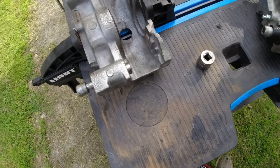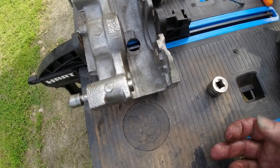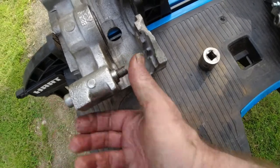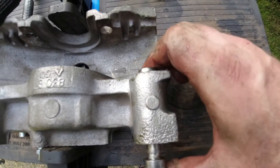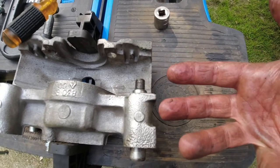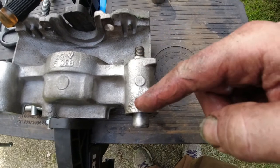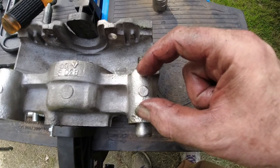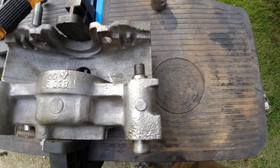I wanted to show an example of when something goes wrong. I just put this slide pin in here using a C-clamp to compress it so it would actually go through. Here's the thing: I should be able to push this back and forth with my fingers easily, and I can't move this at all. If I can't move this with my fingers, the braking system won't work correctly. What I'm guessing is going on is that one of the grommets is slightly twisted or cocked. It's putting enough pressure so I can't move it, so I'm going to have to completely remove this and completely redo it.